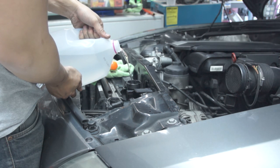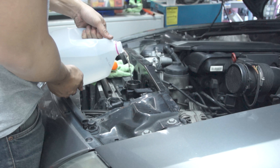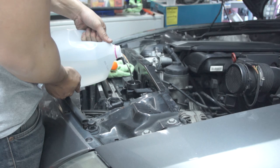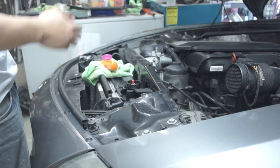What I actually had to do was drive out of the garage onto my driveway, which is on a hill, and all of a sudden the air was actually able to bleed out of the system a lot better. I was actually able to have heat in my car again, which basically tells me that the entire bleeding procedure was done properly.